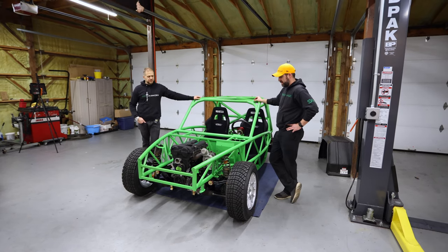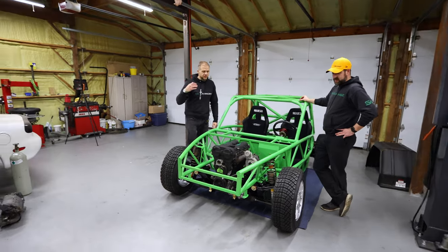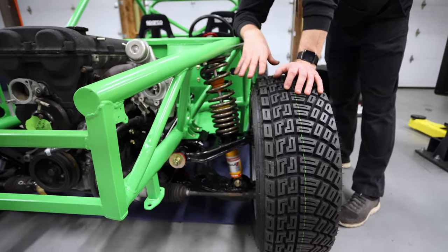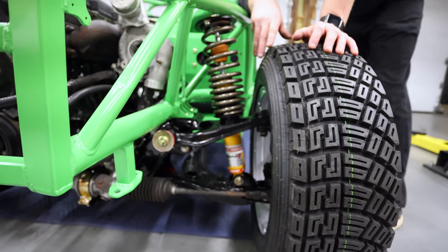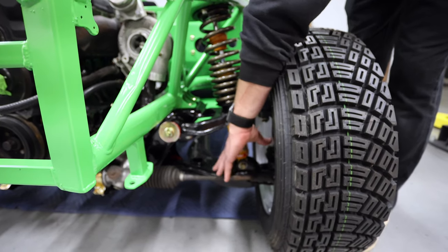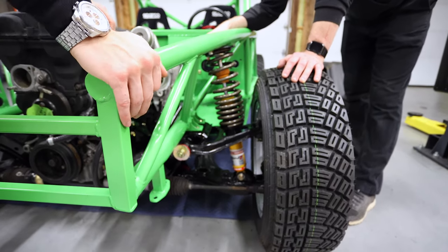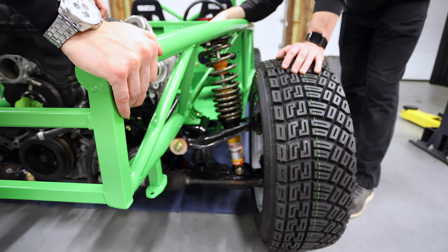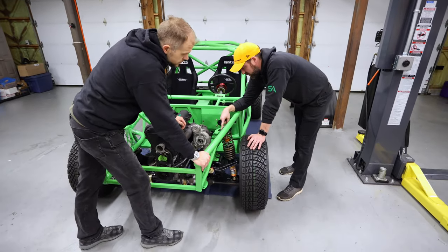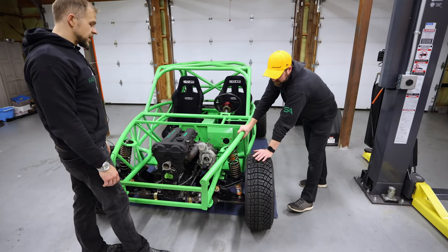These are the Goodwin Racing motor mounts. So these are not Miata coilovers at all - they're actually specifically picked out by Paco Motorsports for their long travel kit. Usually Paco Motorsports has a three-inch lift kit for a Miata which basically just moves the mounting point up, but these are completely different - they're designed around the Miata control arms for the maximum amount of travel. That's the most travel you can get with the stock A-arms. They do sell a kit with replacement control arms that brings everything out and you get a lot more travel that way. They do supply you with upper mounts - this is basically the best shock for it. It's not a standard Miata shock.